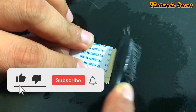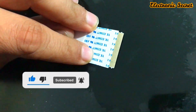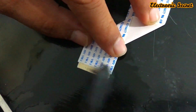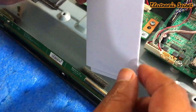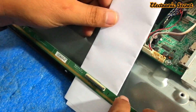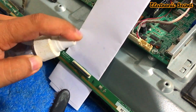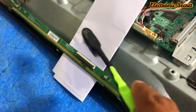Remove the carbon from the pins. The LVDS cable is now clean. Now also clean the scalar PCB connector for the LVDS. Place a paper underneath the connector so the thinner does not go inside the screen, then spray like this and clean it with a brush — you can use a toothbrush as shown.